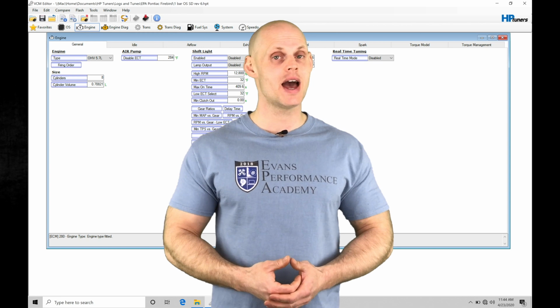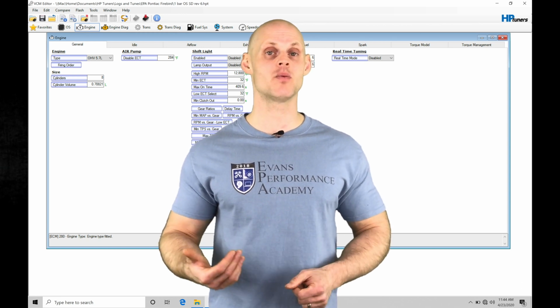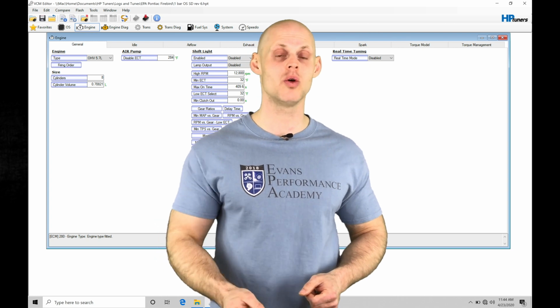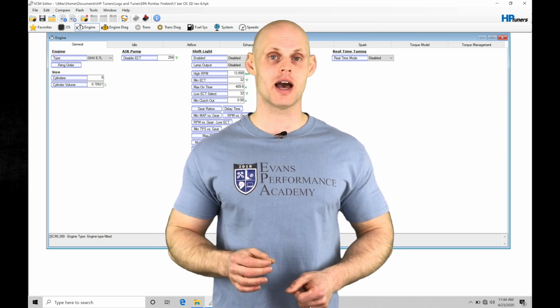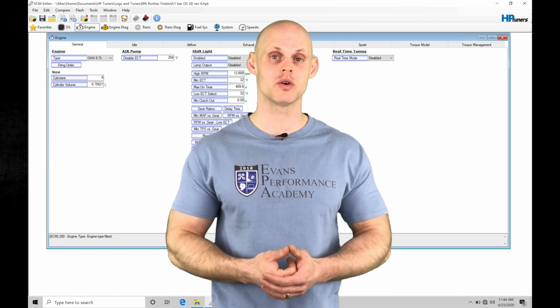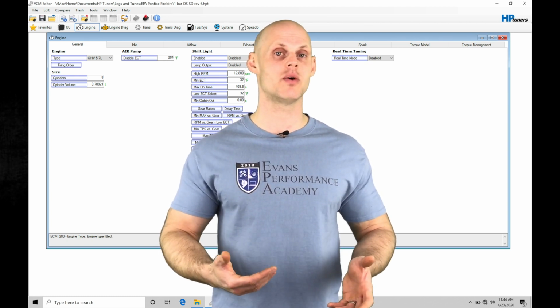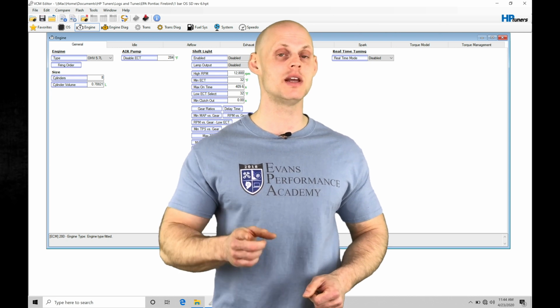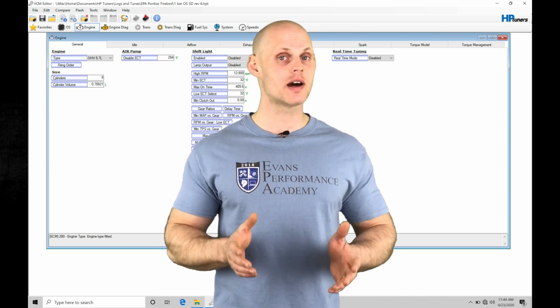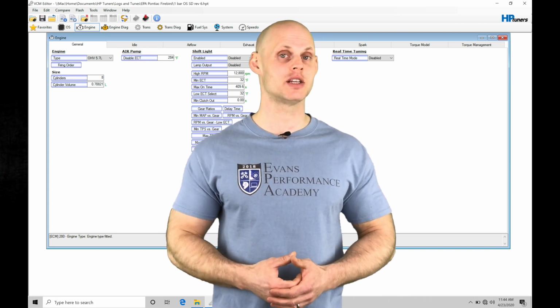training video here. And then we're also going to be looking at setting up and working with our idle effective area. That's going to be one of the last details we have for the idle control. Also taking a look at setting up our fuel injection timing. That's something we haven't talked about in our GM Gen 3 training course, so we're going to be introducing that in this video. I have a nice Excel spreadsheet. It's going to be speeding up the tuning process and populating your fuel injection timing tables.